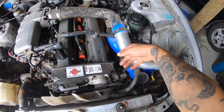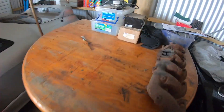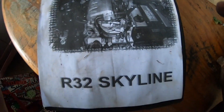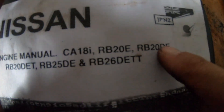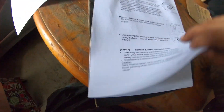Put all your plenum on, your turbo manifold, everything that you would if it was a twinny DET. I've printed off the engine manual from the Neko forum — I'll put the link in the description — it tells you with a twinny head how to take the head off and everything, and then you follow that and treat it all like it's a twinny DET, putting your other tensioner on and whatnot.